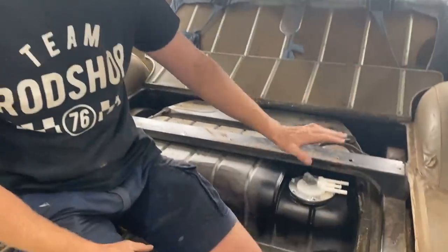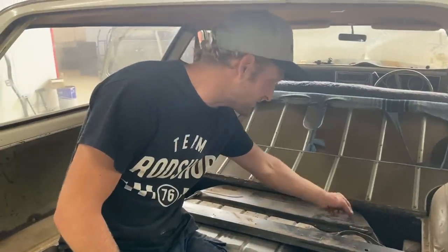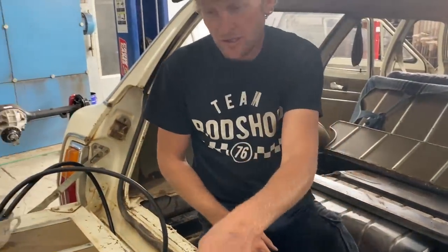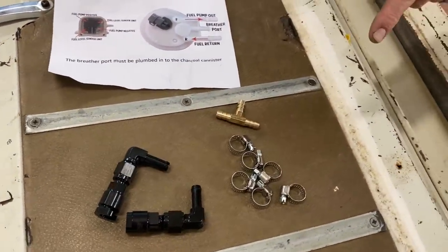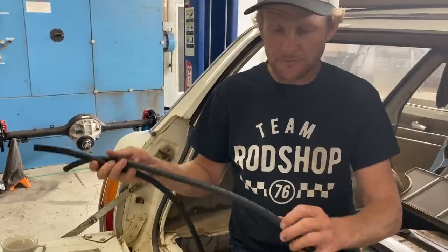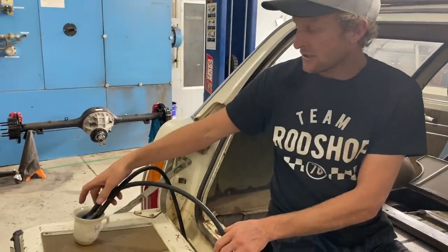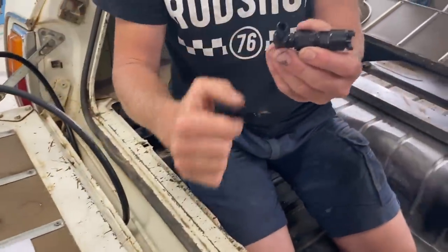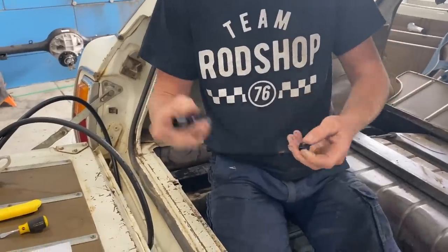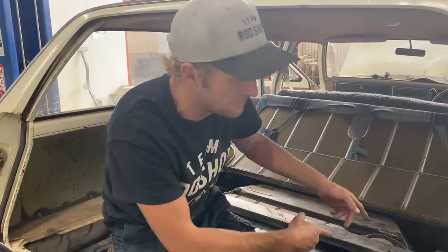To the rear of the fuel system — Jase has lowered down the pump inside the tank so we can clear the floor, great job. The aim is to plumb the pump into the original hard line. We have rod shop rail adapters — we need two of those — hose clamps, a T-piece, some instructions, and I've got fuel injection hose that I'm softening the ends of in a cup of hot water. It has to be fuel-injection rated — we're going to have a lot of pressure, we don't want to blow out a hose. The rail adapters are the next size up so they'll be a little bit tight to push on, but once on they'll definitely stay. We'll run through everything finger-tight first, no hose clamps up yet, and go over it all at the end.